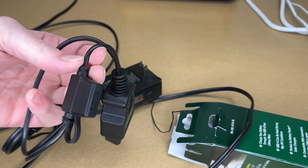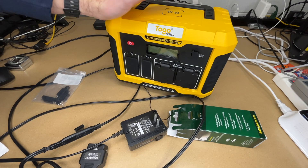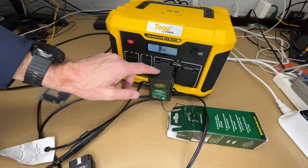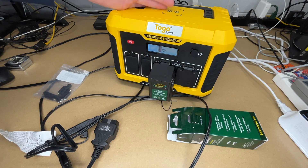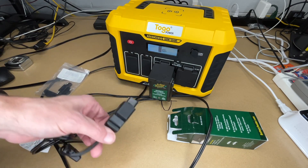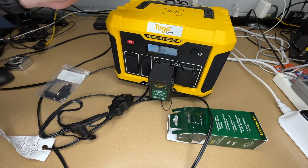The most common use for this will be a solar charger, but you can also use things like this power bank. You could plug this in, turn it on, place it inside the car, and charge the battery. Say you have a car in a parking lot with no power nearby and you can't get the hood open — plug this in, leave it for hours till it charges, then have enough power to start the car. This is always going to be a relatively slow charge method, so you're not going to use this to jumpstart a car — just stick it in, let it slowly charge, then go start it.